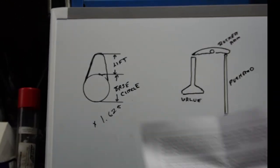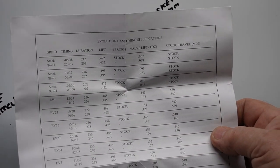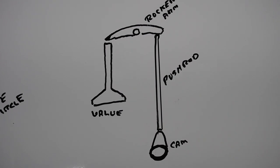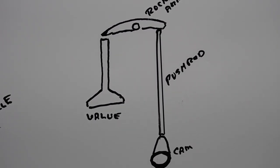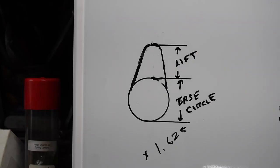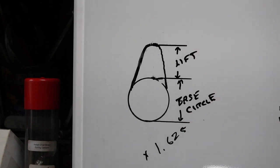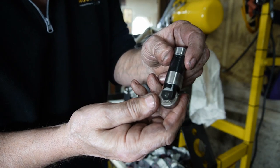That'll give you a rough estimate of where you're at. All of the cam specs shown are in degrees of rotation — crankshaft degrees are always the same; RPM is what changes everything. This sequence of events happens very fast as rotation continues. The crankshaft itself completes two complete revolutions — that's what makes it four strokes of the engine cycle — while the camshaft only completes one revolution during the same time. The camshaft actually turns at half the speed of the flywheel assembly.